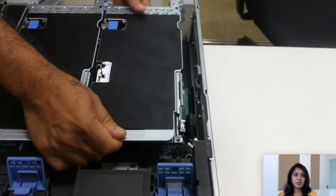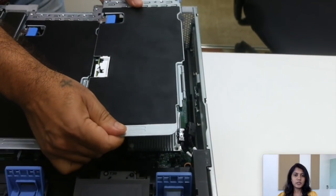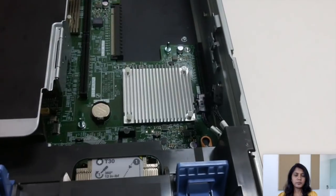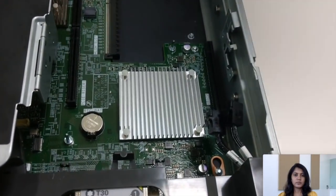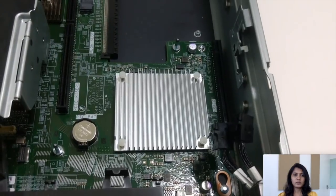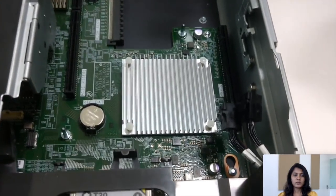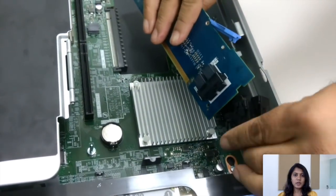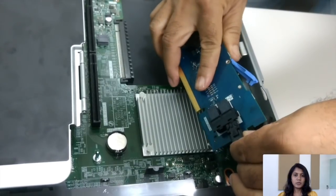On the right-hand corner there is a dedicated storage slot. We are going to install this card on that slot. First, we are connecting the A1 and D2 connectors with the drive backplane, which are connected to the eight front-facing SATA drives.